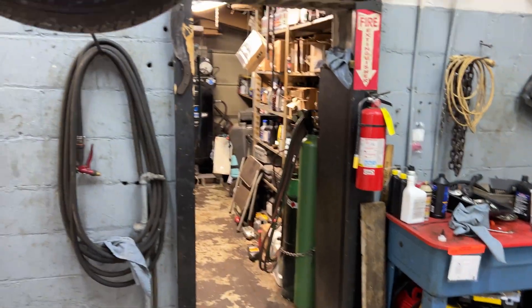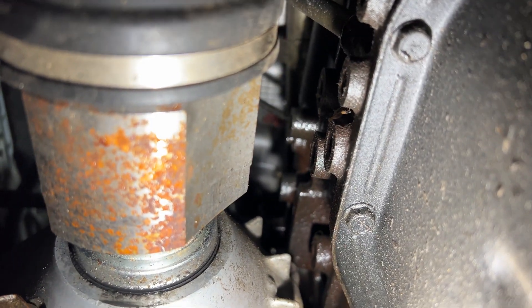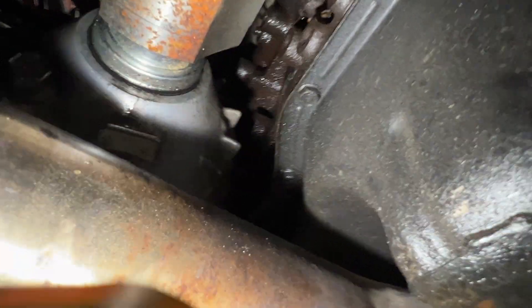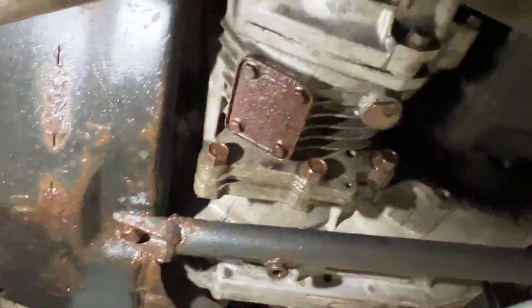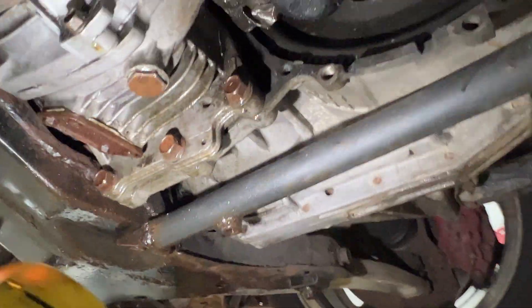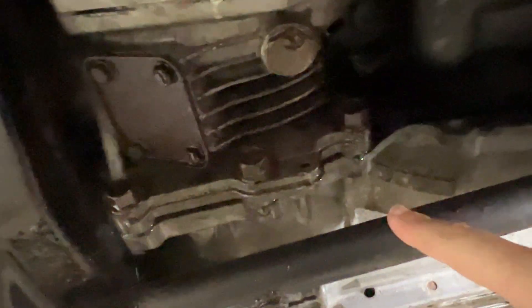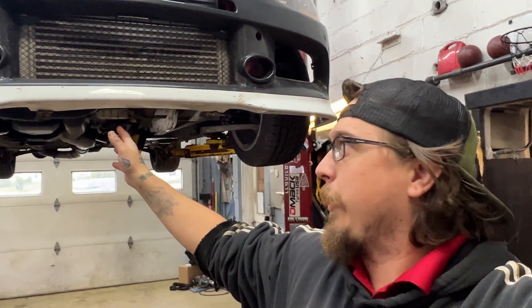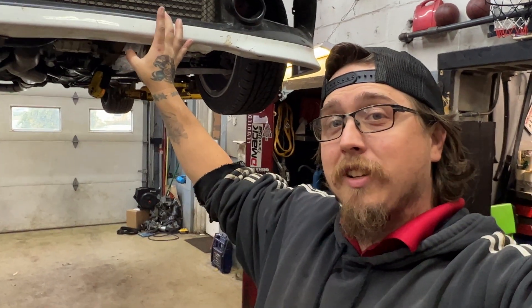The knock sensor wire is accessible from underneath — right up in the middle of the car. I'm going to wait to do it though, because I know the car isn't actually knocking. The reason I'm waiting is I have an atrocious transmission fluid leak. When cars sit for a long time seals dry up, and the seal between the transfer case and the transmission has started leaking. Driving season is almost over in Wisconsin, so I'm going to try finishing up the tune and come spring the car will be good to go. There'll probably be a video on pulling the transfer case.